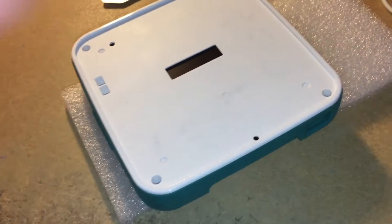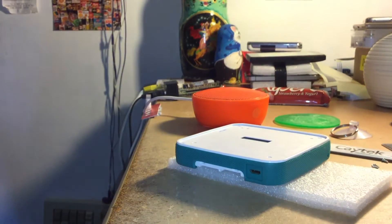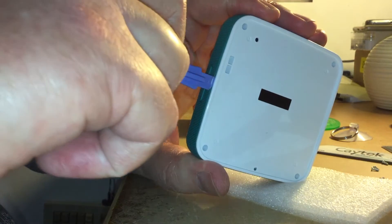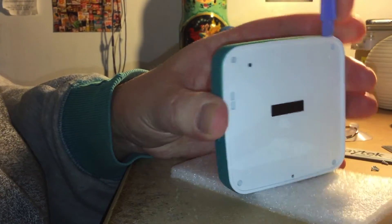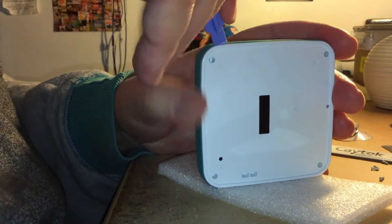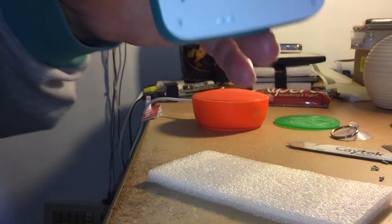It's not easy to do one-handed. I'll just put the camera there. So get the pry tool and I went above the power button first and gently pry upwards. There are little clips around the edge like in most of these electronic gadgets — little plastic clips and tabs inside — and you pry around the edge and the top part will come off. Don't use a metal tool because you'll mar the rubber. The plastic bits come off the top but that's not the end of the world, it's just a glossy plastic thing that's going to get scratched easily anyway.